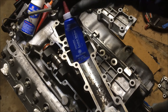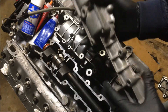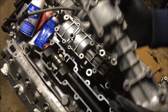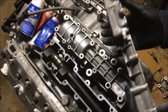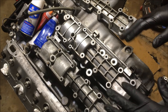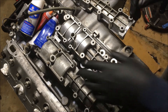A lot of people that I've spoken with actually prefer this over the 574, since if you're going to be doing this every day you want the gasket material to come off easier. However, I'm not going to be putting that back on there — I've actually got some 574 that I'm going to use for this video, since I'm not planning on taking these back off again and I want to demonstrate the way the factory service manual says to do it. I have made a few videos on balance shaft covers before, but they seem to get lost in longer videos, so that's why I'm doing this — so it can just have a video of its own.